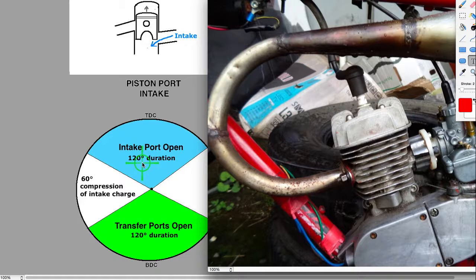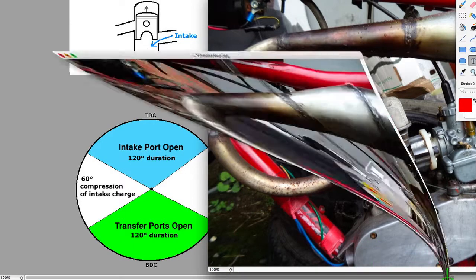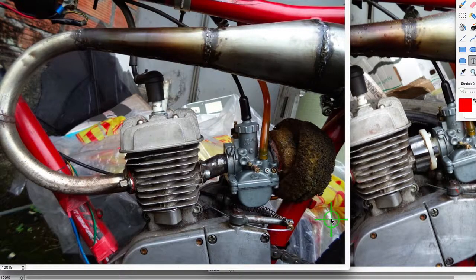They come with piston port, so just find out how much you need to change the bottom opening of the port, and get a rotary tool with a thin cutting disc and use that. Some people shy away from porting because they think it takes expensive tools to do it — no, it doesn't.